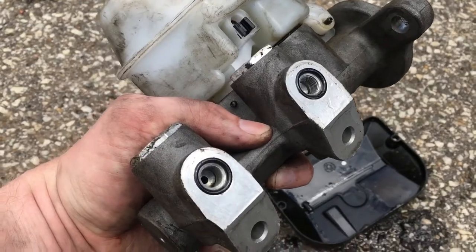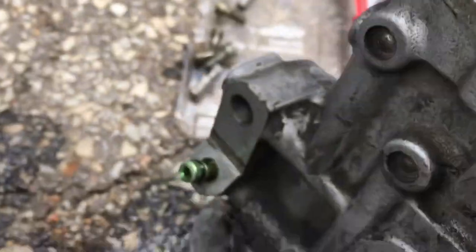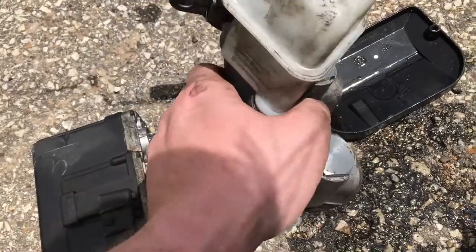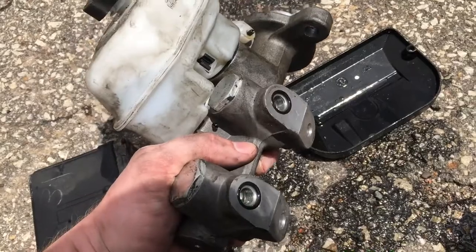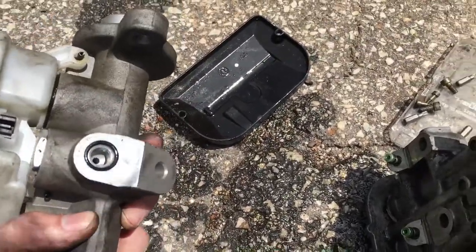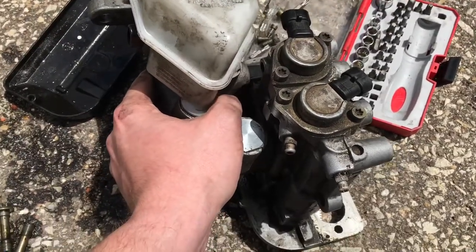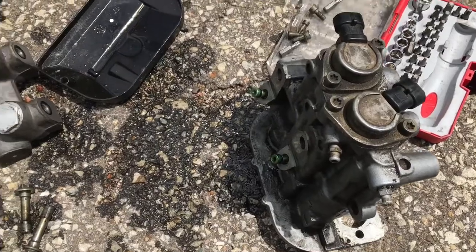This slides onto these two holes right here, which slide onto these green pieces here, and that's just going to sit on there. You're going to push it back on when you're done. What I recommend is if you're putting a new one on, make sure you bench bleed the master cylinder. There's tons of videos on YouTube on how to do that — it's a pretty simple process. You just need to get all the air out of the master cylinder before you reinstall it, because if you don't, you're going to end up with a spongy pedal and your brakes won't feel responsive at all. Like I said, it'll slide back on like that when you're done. Thanks for watching and have a great day.